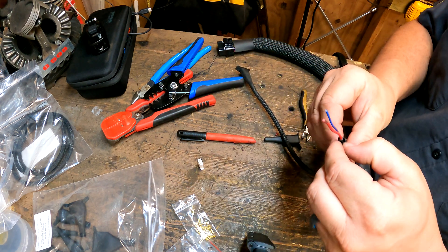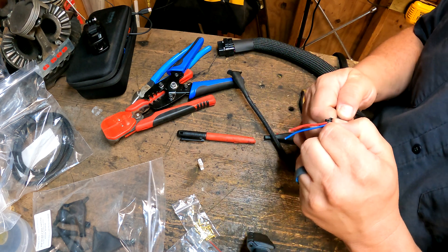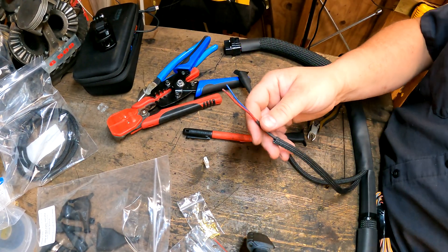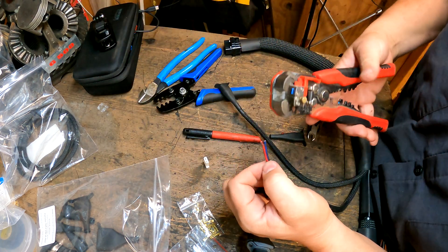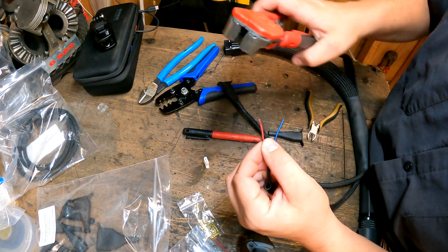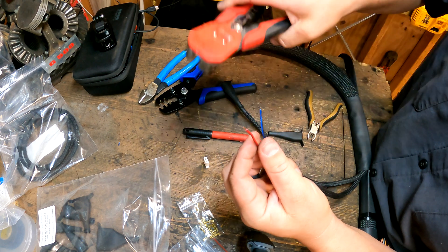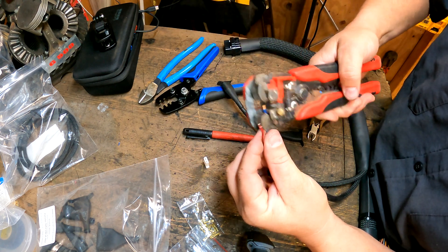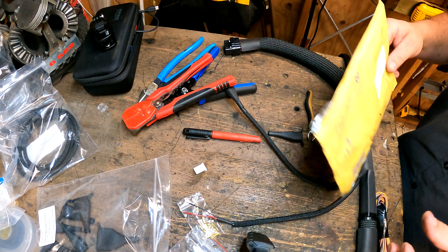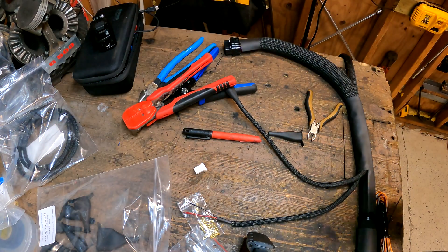So here's what we're dealing with. First thing, we're going to take off this tape — this is just really a placeholder. I am heat shrinking at the connector end because there's really no other wires that could need to come here. I've cut them to equal length here. You only need a very small amount stripped off — maybe a quarter of an inch, maybe even a little less than a quarter of an inch. Make sure that the little pieces that you've stripped off fall out, otherwise it jams up. Now I did go ahead and make myself a diagram so all the injectors are the same. I want the positive red on the left and the blue and trace on the right.